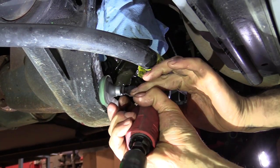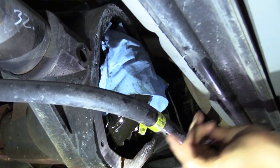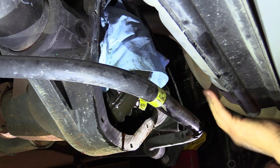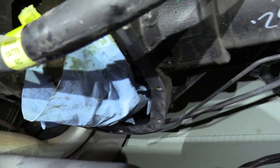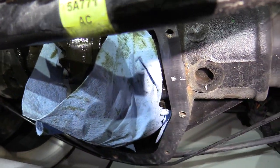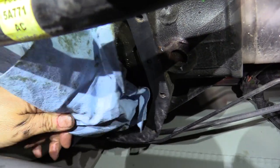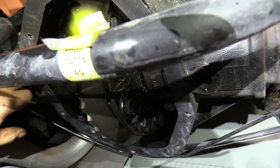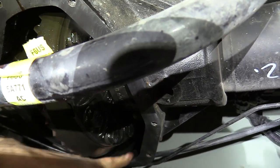This here is my roll lock disc. We're going to go around and clean that whole sealing surface. When done, I'm going to take a can of brake clean solvent and flush out the whole housing to knock out any old oil and oxidation. Silicone itself isn't going to cause you a lot of problems, but I try to get as much of that stuff out as I can — I just don't want it in the differential.